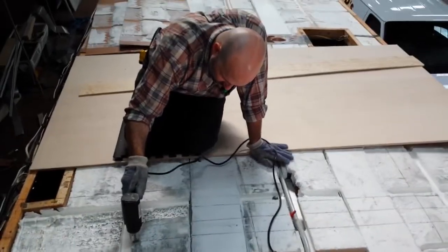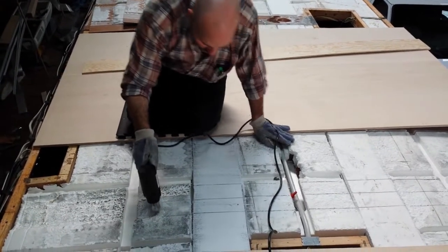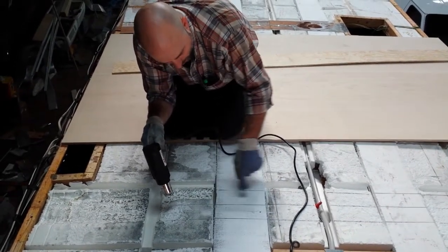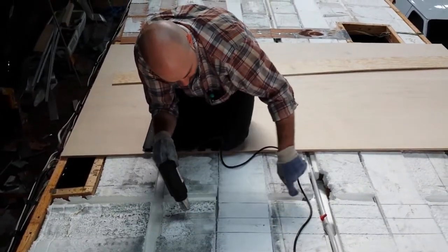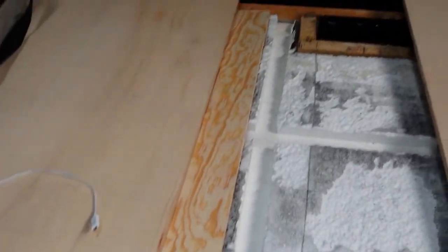I put the roofing sheet of plywood down where it was going to be, then using a Sharpie marker, I drew on the foam where the edge fell. Then I moved that roofing sheet back out of the way, and using that mark as a center line, I marked 3 inches in front and 3 inches behind it to give me my 6-inch channel markings for the area I needed to melt. That way, this 6-inch joint piece would be centered between the two roofing pieces.